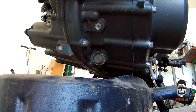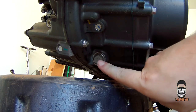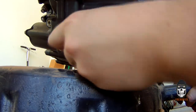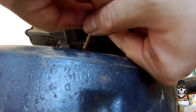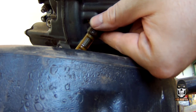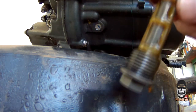The second drain plug is on the front of the engine block itself, and for this one you'll need your socket wrench and a 13 millimeter socket. It's important to note that this screen is attached to the plug when you remove it, so slowly remove it straight out — don't pull it to the side right away or you risk snapping it off. Wash any debris or deposits off of it and set it aside to dry before reinstalling. While it's not necessary to replace these screens at every oil change, if you notice anything damaged I'd suggest getting an extra pack. Links will be in the description.